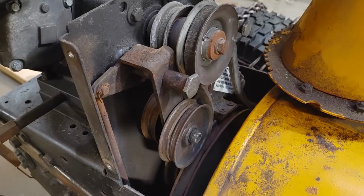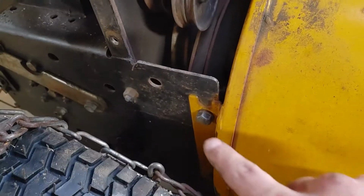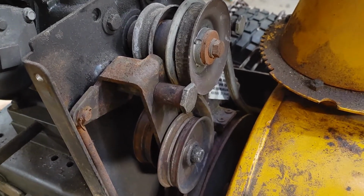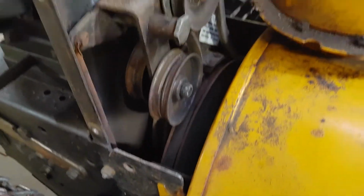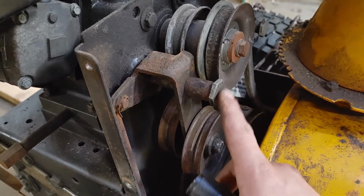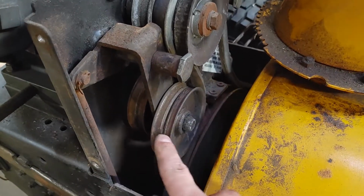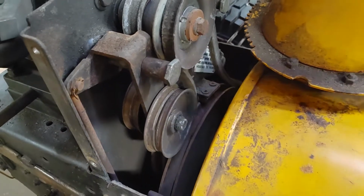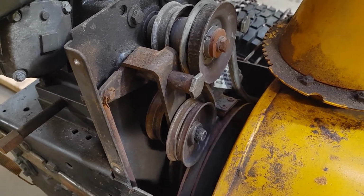The housing is now reconnected to the motor. Remember, there was this pin down here, it just kind of hinged on, and then these ones just held it on each side. On this side, it's on the outside, and the bar is on the inside of the other one. So it just sits in there. They're equal width. This yellow piece to the other side is the same width as this black piece to the other side. But then, yeah, reconnect this bolt and this one that hold the pulley in here, or the belt. Make sure that this works again. Just tighten it up and then make sure that the brake there also gets applied. And then put the shroud back on and try it out, see if it works.